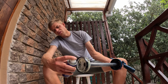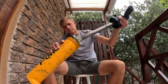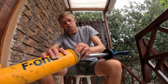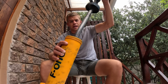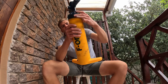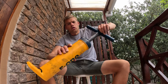Also spray the valves, seals, and the bottom itself. Then put everything back together — put your seal back in there and make sure everything sits in there nicely. It might take a little persuasion to get the seals back in correctly, so be gentle so you don't rip anything. Slowly work your seals back in, then push it down and screw everything back together. Give it a couple of spins and turns just to work that lube everywhere.